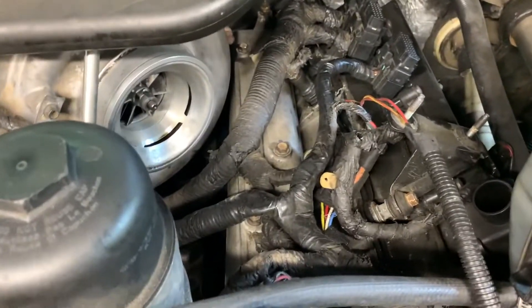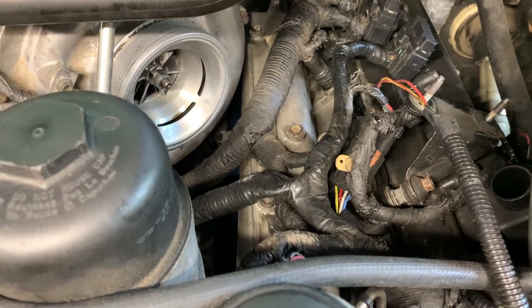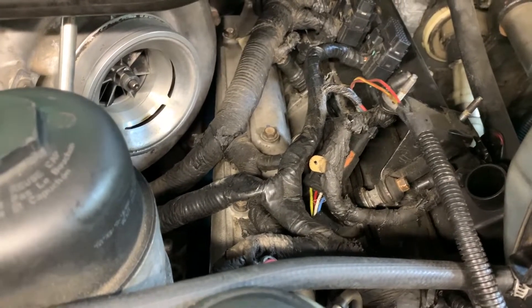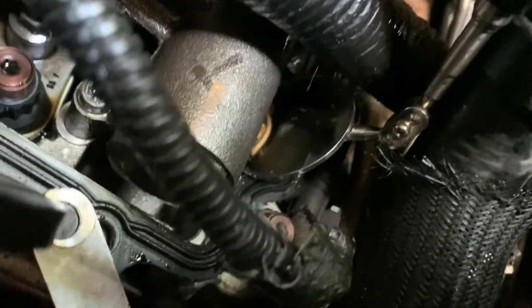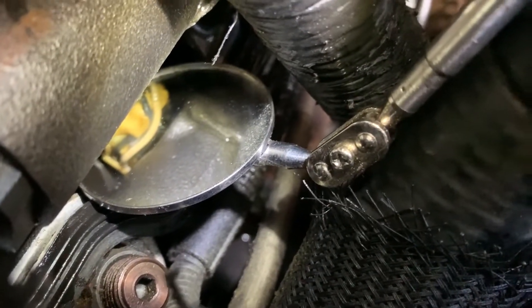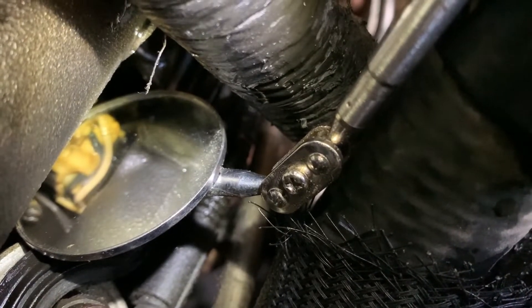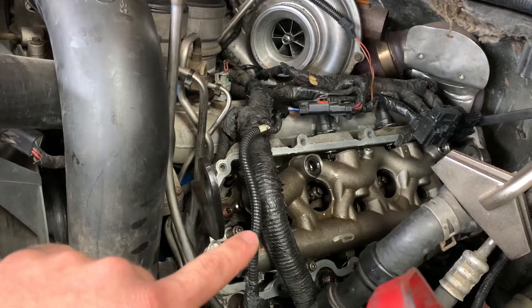So we've had our air on here for a little while. This is a no-start hot, so it's a little bit harder to trace the leak by sound because it's not going to be a wide-open leak as if you had a no-start cold or a no-start any time at all. I've got a hiss there on this valve cover. Now you can hear that air better. I've got my mirror sitting right down there. I poured a little bit of oil and it's right there where the nipple goes into the top of the injector — that's your leak.